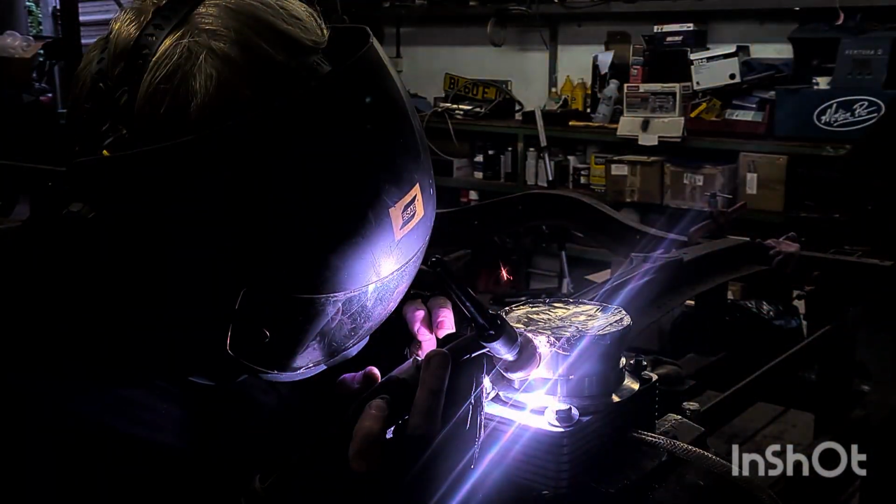I've been really busy doing everything other than actually installing the turbo on the truck, but all we have to do is put the downpipe on, modify the flange for the downpipe and reduce it down from 4 inch to 3.5 inch to fit the new flange. So let's get that done today.